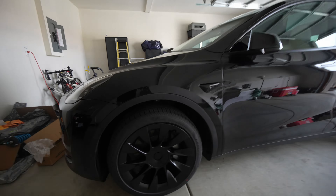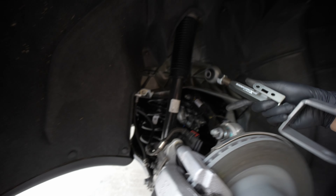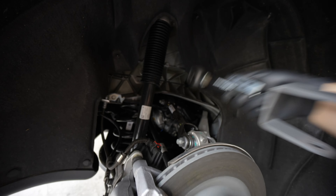We need to remove these two bolts right here to get the shock out. In order to do that you need a wrench on the other side so it doesn't free spin — there's a bolt and a nut. We also need to remove the upper camber adjustment arm. There are two bolts up there and the whole thing should come out. I want to have rear camber adjustment so I'm going to go right here.